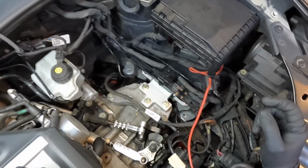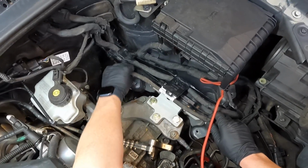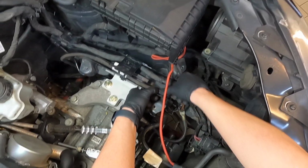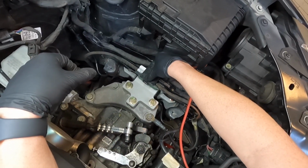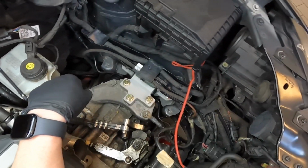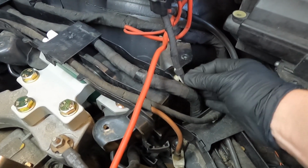After we do the large wiring harness, we're gonna do the same thing with the small one. Just go ahead and put it back in its tunnel. Line up this back clip, clip it in. And then the same thing with the front one. Close this door right here, and this door. Go ahead and snap that small black wires clip back into the tunnel.